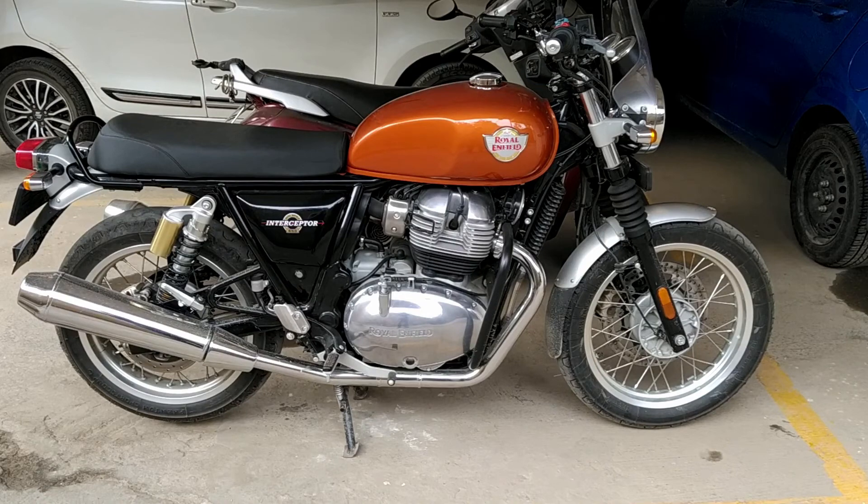The last step is to ride the bike. As per the instructions, ride for about 10 kilometers under 40 kilometers per hour so the liquid gets completely coated inside the tire or tube. Please ride below 40 — don't go straight to 100. Thanks for watching, and if you want any of these products, links are in the description below. Do like and subscribe if this video helped you, and I'll see you in the next one!